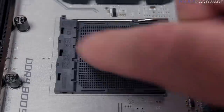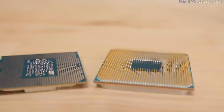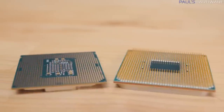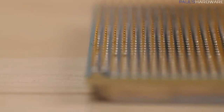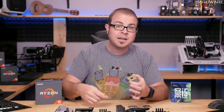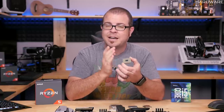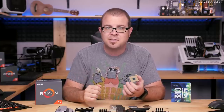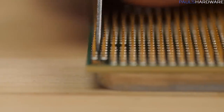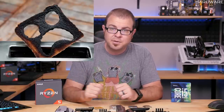One of the great things about PGA is that the motherboard socket is much more durable. With no delicate pins on there, you don't even really need a cover for the socket like you do with LGA. The pins are on the CPU side though, and while they're not as delicate as LGA pins on a motherboard, they are exposed and can be bent or even broken if handled improperly. My advice is to keep the CPU in its protective clamshell until you're ready to install it, and never try to force the CPU into a socket. Fortunately with PGA, a bent CPU pin — or even a few of them — is not the end of the world. I personally repaired probably at least 100 PGA CPUs with bent pins. I basically just had to use a razor blade, steady hands, and lots of patience. Do this at your own risk, and remember that if a pin breaks off, your CPU is toast. But it is certainly a lot more feasible than repairing a damaged LGA socket on a motherboard.